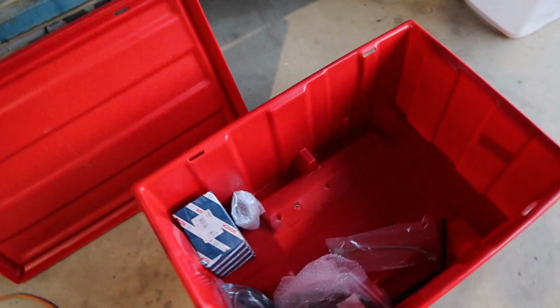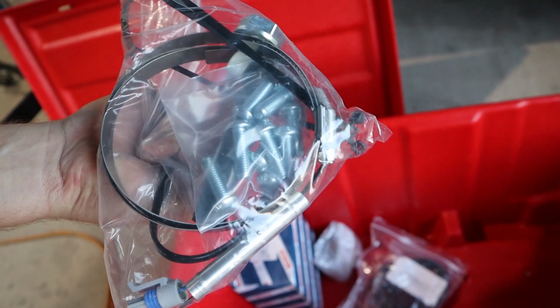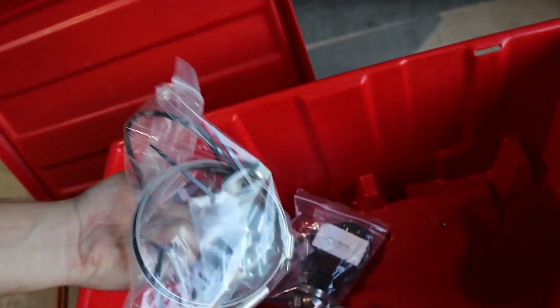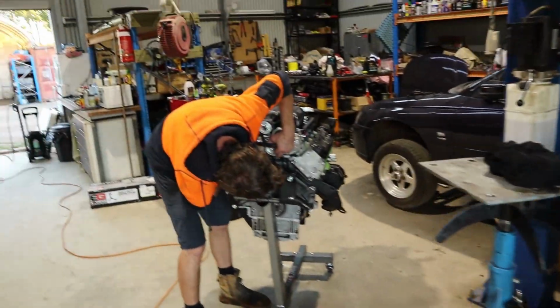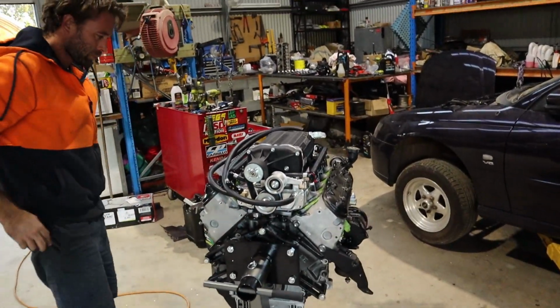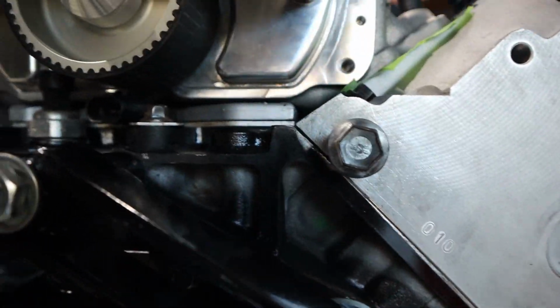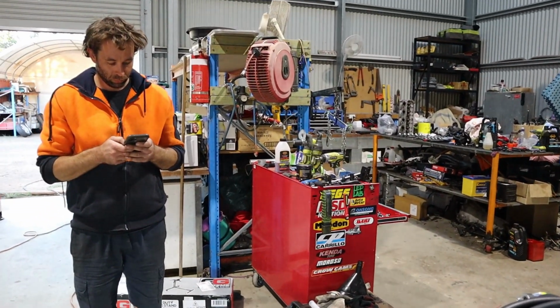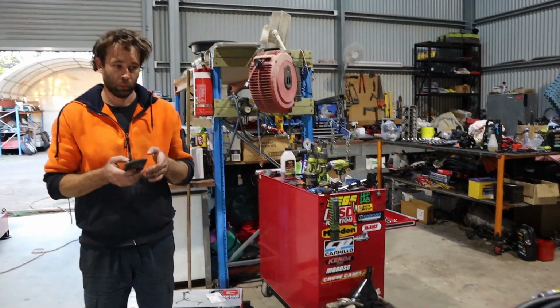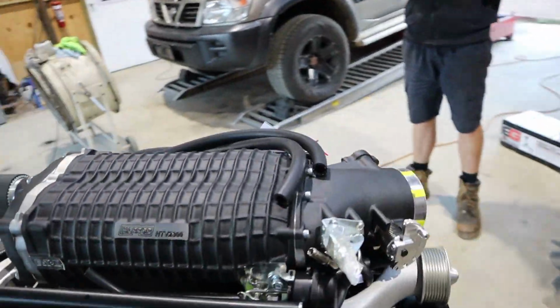So it would appear that we should read the instructions as always, but there's the box here with 10 button head Allen key bolts, which we're assuming are meant to go in place of those bolts on the valley plate. But even then, they're still going to be so close, it's wild. I suppose, how thick are the intake gaskets for it? Or are they just O-ring seals on that? O-rings. Oh, okay, well, there you go. Yeah, so it's still going to be freaking tight.